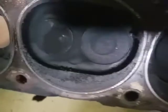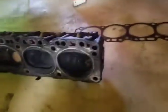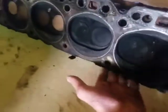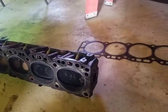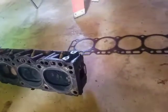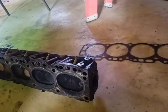The exhaust — we've got a few exhaust valves that are pretty pitted, and I'd almost call this one burned. When I first bought the truck, I had a blown-out exhaust manifold gasket on these two cylinders. There was a fire hazard, stuff blown out everywhere. I replaced it and it ran a bit better, but not that great, and it always popped out the exhaust like that.